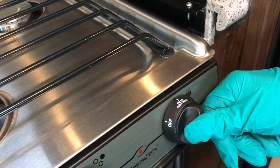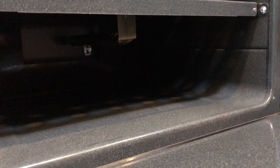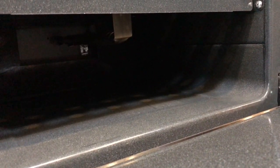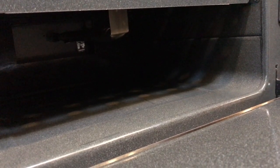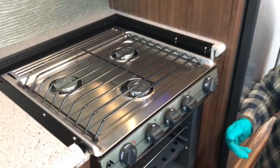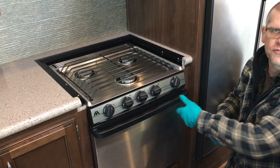And you would push and hold with your barbecue lighter down underneath until the pilot light, which would be way in the back, lights. You want to wait till the pilot light lights, holding this until that pilot is well established. It might take about 20 seconds, and once that's done, you turn it into the burner mode, and you'll see your burner ignite. If that fails, you'll just need to start over. Nothing wrong with that. It's very common to have to do it once or twice.